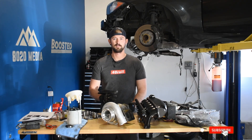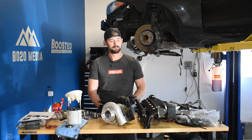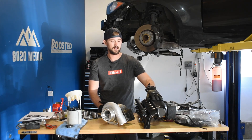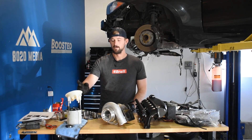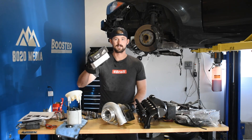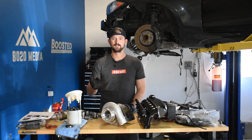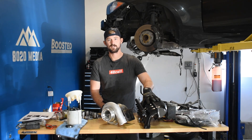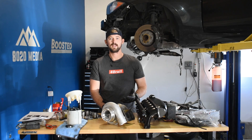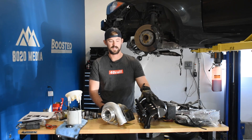Last video I had just finished up all the preventative maintenance on it. My plan was to jump into fueling and get all of the fueling set up from that point. I do have the port injection all set up and ready to go. The manifold just needs to go on. And I did get the fuel pump out of the car, but I do still have to build the fuel pump because I bought the DIY kit to save a hundred and something dollars. I need to take that apart and get it built. I didn't install any of this yet just because the rear turbo inlet is still on the car, and getting this on there with the rear turbo inlet on is a little bit of a challenge. But that inlet has to come off anyways, so it just makes sense to pull the inlet off first to make this a little bit easier to get on.